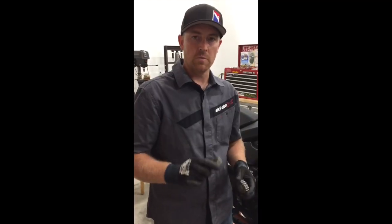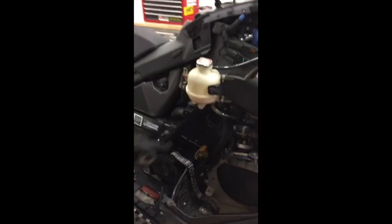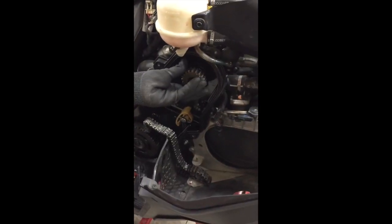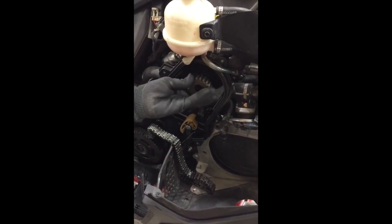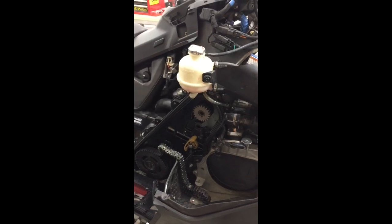All right, today's video, we are taking care of a lot of the odds and ends that need to get done. So let's get to it. All right, we are gearing down this sled. So we were going from a 21 tooth to a 20 tooth. So we pulled the chain case off, and now we just put this guy on here somehow, and then put the chain back on. That's just gear down kit.